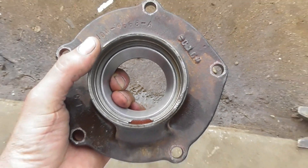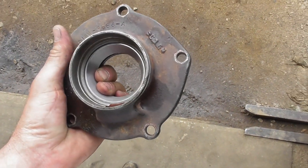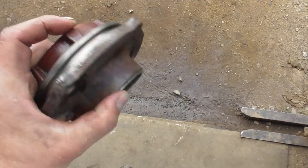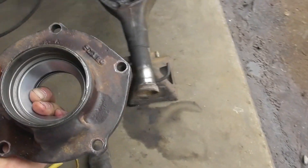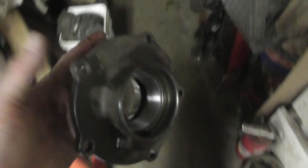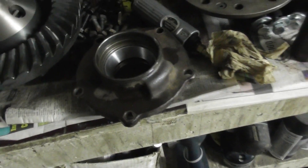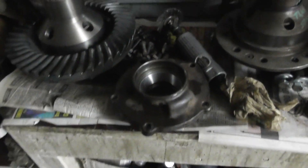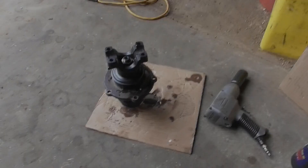Really, when you tighten the pinion down you should not put a crush sleeve or a solid sleeve in it — tighten her down pretty good so they kind of even themselves out in there before you do anything, so they're seated. That way they're seated in there, just like you would your front wheel bearings. You over-tighten them to begin with, then you back it off and then you do it again, so you know the bearings and the races are all seated where they need to be.